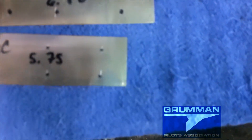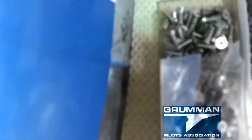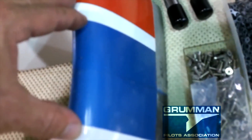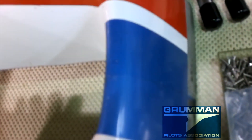We've drawn our parallel lines and marked all the holes to drill on all the pieces. We've also taken our blue tape and transferred our cut lines with pencil into the fiberglass all the way around — including the tops on the rim around the spinner hole, and down the sides. That's where we're going to be cutting. Cutting is the last step we do. Before that, we will match drill everything into place so we don't change any dimensions of the nose bowl. If you cut it first, you lose the 1/32nd, so we want to have that 1/32nd gap while we do the match drilling.